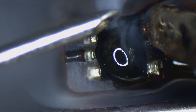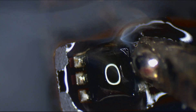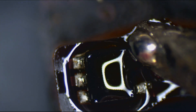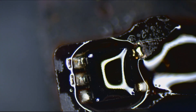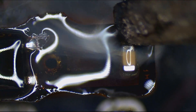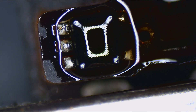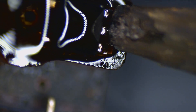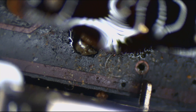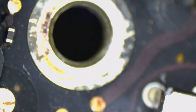After scraping away the corrosion, we clean it off with alcohol and put a little bit of flux to touch up the connection. That is not an appropriate amount of flux — likely this will not work. A Hall Sensor is going to detect magnetism. The way this machine works: there's a magnet in the screen and a Hall Sensor in the palm rest. When you close the machine, the Hall Sensor detects that the magnet is close and tells the machine to turn the screen off. When you open it, it tells the machine to turn the screen on. If the Hall Sensor is corroded or broken, it thinks the machine is closed when it's open — that's causing our intermittent video.